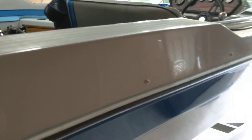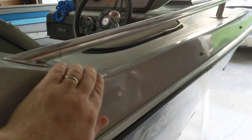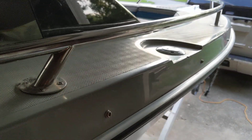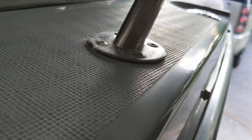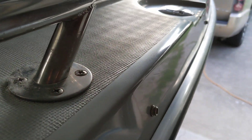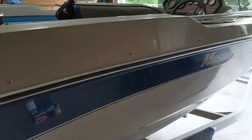So that's how you do it. I'll show some more videos and try to get footage of actually doing the polishing with the buffer. It's amazing how different this is — this boat has never shined like this since I've owned it, and it sat out in the sun for four seasons, a good portion of that time not covered. You can see there's a little haziness where I didn't hit it really strong — that's oxidation and pitting. If I were to wet-sand that, it would come out super smooth. Since this is the first time I'm doing it, it's not perfect, but each time I do it again it'll get better. That's how you wet-sand and polish a boat.